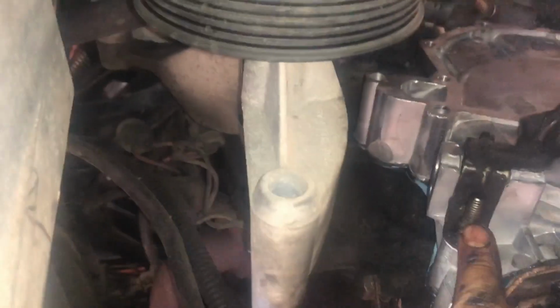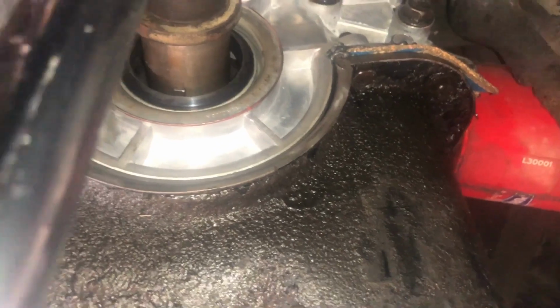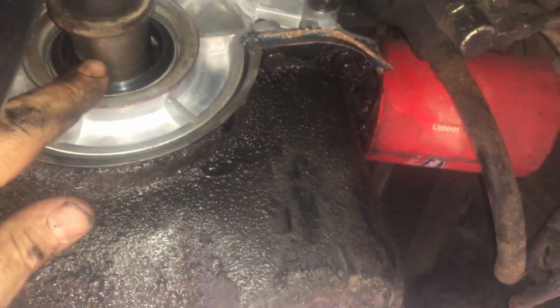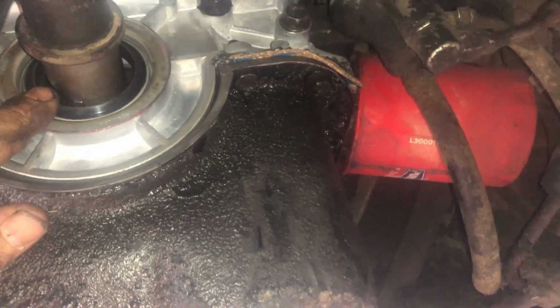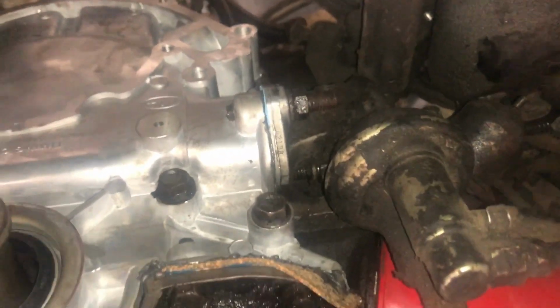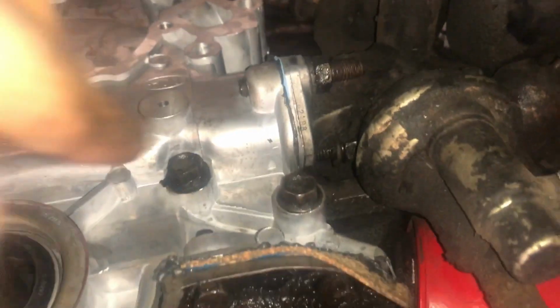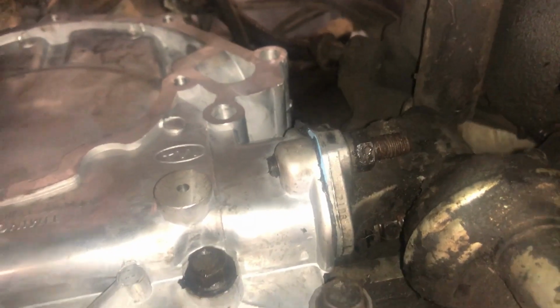We got our little bracket here with the studs. Our bracket's going to go back to our eliminated air pump there. And if we turn the crankshaft so the keyway is about 7, 8 o'clock, then you can fit that fuel pump lever in easier. And it's tricky to get that back one started. You can see I have it started. Got that one almost tight.